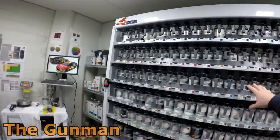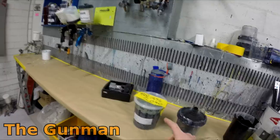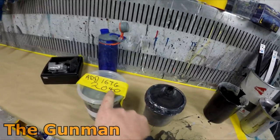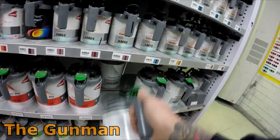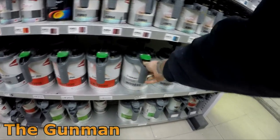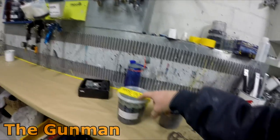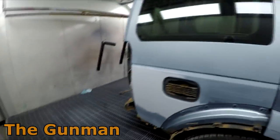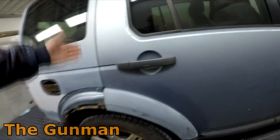Got the tint stirring — they say to only stir these once a day because you can actually over-stir water base. I've got the paint for my next job mixed up, but when mixing this water base with the 2040 I left that out when I mixed it up — it's basically like thinners. They say once it's in there you've got a 24-hour window, so I've got it all mixed and I need to add my 167 grams of 2040 and then do a spray out.